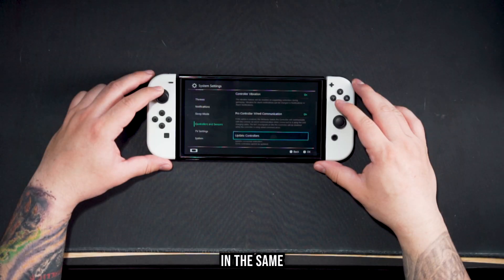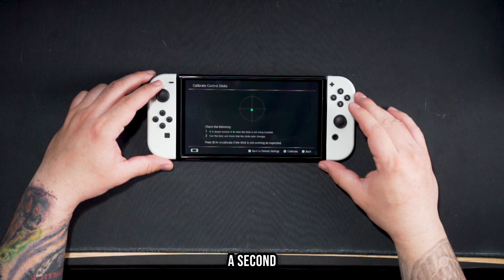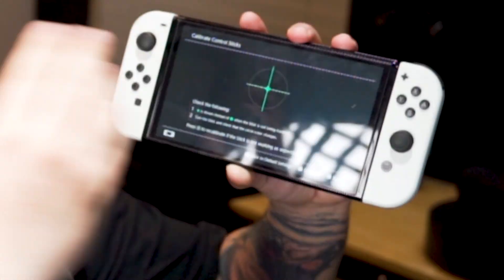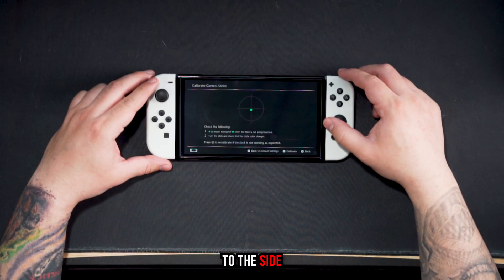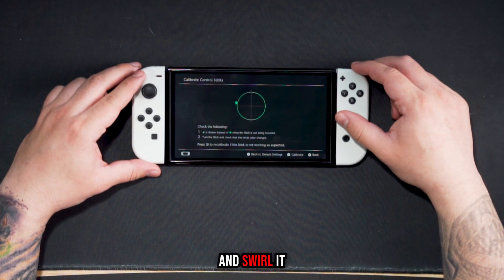Next up, we're going to stay in the same settings, scroll down once, and calibrate our control sticks. You're going to need to identify if it's the left or the right Joy-Con giving you issues. Let's say it's the right — tilt one of the sticks over to the side and it will open up. You'll most likely see some ghost shakes; it's going to be flickering and shaking and moving without you touching the stick. If it's not doing anything, pull it all the way to the side and let go rapidly on all different sides. Swirl it around and let go — sometimes that will set off the stick drift.